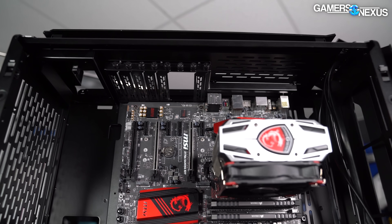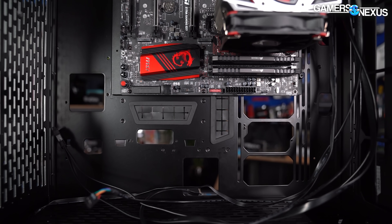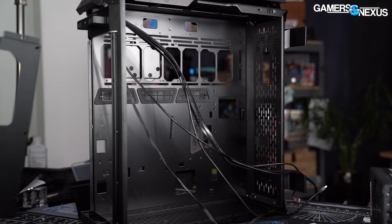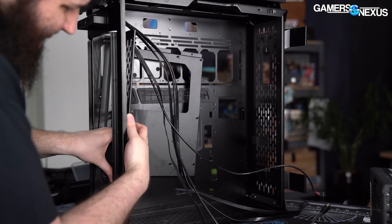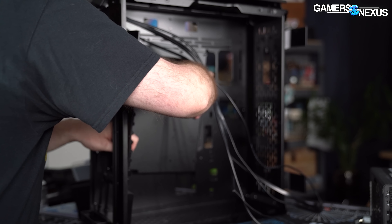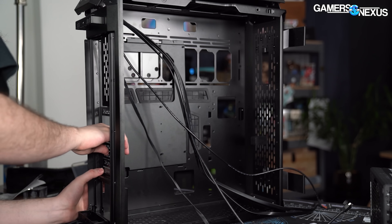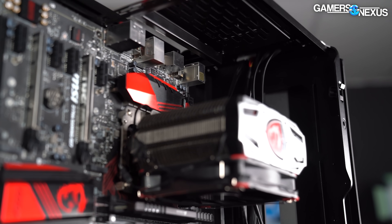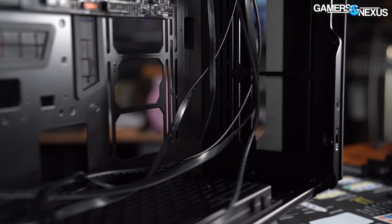Here's the Dynamic R layout. The bottom and front fan slots are available, with rear and side fans largely obstructed by the power supply and the motherboard tray respectively, although Lian Li doesn't mark them as options in the manual. We opted not to test this configuration for thermals — the primary two configurations already required a full case review apiece, and this one is really just a by-product of the performance layout. It's essentially what you get if you start setting up Performance and stop halfway. The motherboard is merely rotated rather than fully inverted, meaning the primary intake slots are poorly situated to benefit either the CPU or GPU compared to a standard layout.